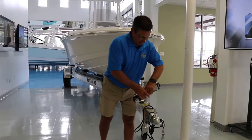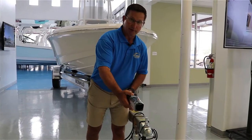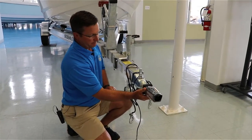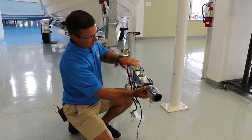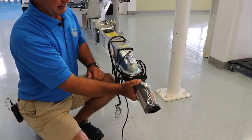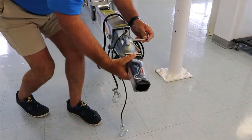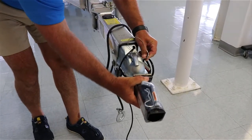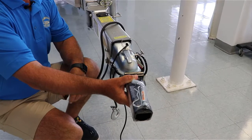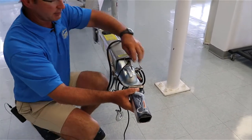The first thing you're going to do — this will pretend is your car, and that's the hitch. That's going to slide into the receiver on your vehicle and basically slide up in here. Once that ball is in there, you're going to drop this down and you can see it's not coming out anymore. Once that is firmly in there, you have a safety pin. That safety pin is going to go inside and basically keep that from releasing — it will no longer pop up. It's a nice little safety feature so if you hit a big bump or a pothole in a road, you know it's not going to come loose.